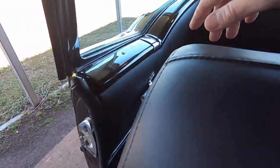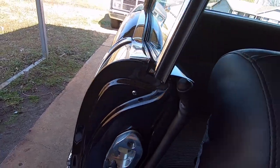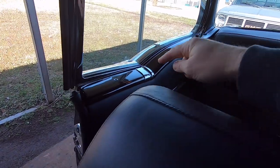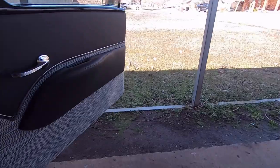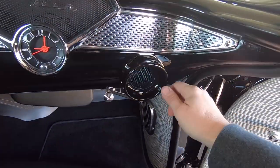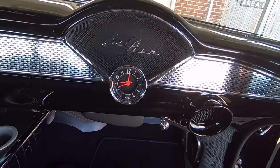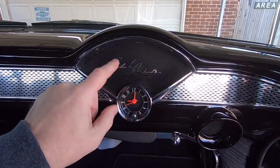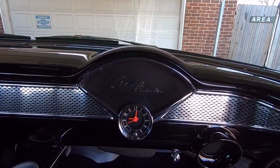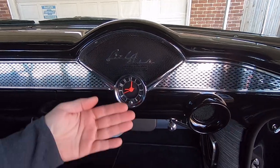I formed original paint dividers from a sedan to fit and curve around the B-pillar — a very difficult piece with those beads in it. I made my own package tray using the same grille mesh as on the front. I used exhaust tips from Pep Boys as speaker pods since they have a rolled edge — there's one on each side of the dash with metal mesh. For the package tray speaker opening, I built a block-off panel and bonded in the side of a '55 Chevy Hot Wheels car — it looks like it's stamped into the metal.